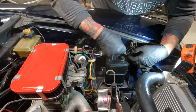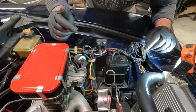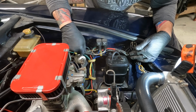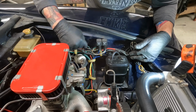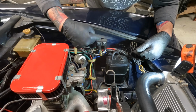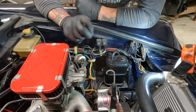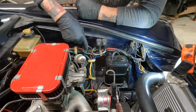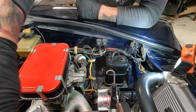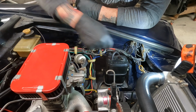It plugs into the green wire and the gray wire that go to feed the headlights. So you're going to have to kind of match them up. This relay's gray, it plugs in here. This relay's green, it plugs in here, because it's high-low or low-high depending on how you're wired. It's confusing, but not really. And then to run the other side, the kit just has an extension, so the relays feed both headlights, and it runs all the way back around and plugs into the connector over there to go to the headlights. Same color, green and gray.